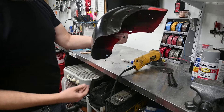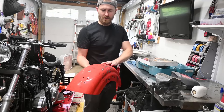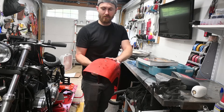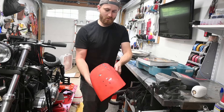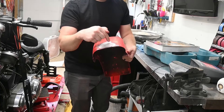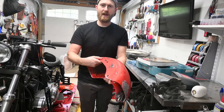Not too bad, not perfect. After stripping the old spray paint I hit it with a DA sander just to scuff up the original paint. I don't need to bring it all the way down to bare metal — the factory does a better job adhering to metal anyway, so I'd rather piggyback off their finish and prime right over it. Where I had previously chopped it and the tail light had mounted, I filled those holes with weld, bondoed over that, and smoothed it out. I'll redo that and hammer out some flat spots too.